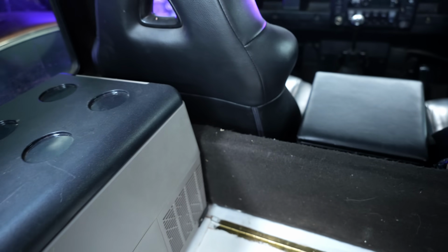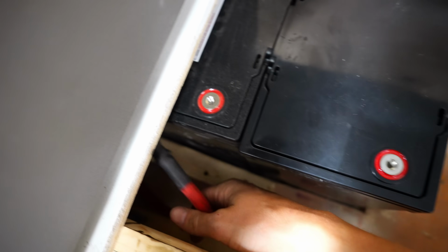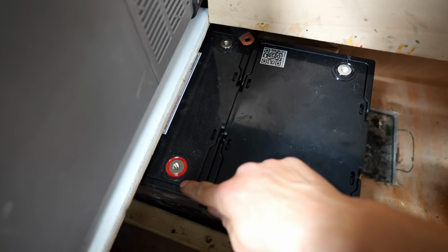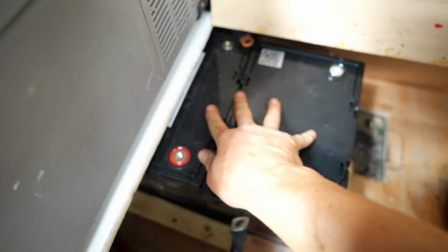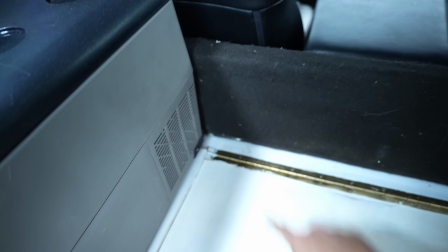All right, so all my electrics are actually behind this seat. I'm not gonna show you because it's absolutely disgusting. Did it at 5 AM on the night before we went to Europe. So it is an absolute mess and I need to address it at some point, but we have a negative cable coming out there, and then we have the positive here. So basically, negative to there, positive to there, jumper cable, and then we have a 200 amp hour battery bank, and it's all connected to my 12 volt system, which is down there, don't look.